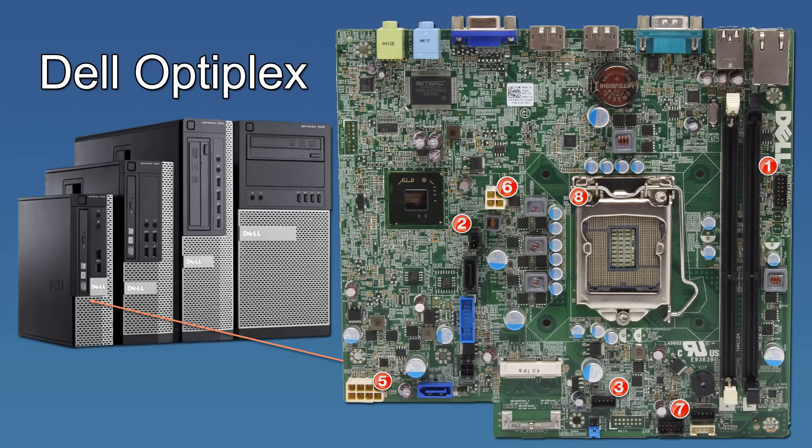Another issue is the USB pin layout — it's got its own adapter and can cause more problems. Dell have really thought about everything to make it virtually impossible to easily transition the innards out into another case. Most people who do it will just leave the sensors in and jumper the start button on the case to get it to boot, losing a lot of features. Also, the front panel header uses smaller, thinner pins, so standard case cables slide in and out without a good connection.